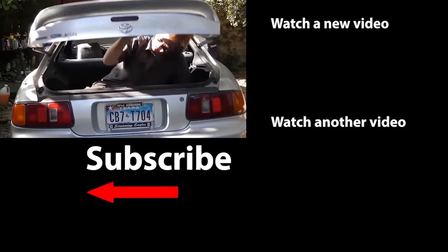Now that said, and if you find it's going to cost you $700-800 to change the heater core, you might try this. And I've seen it work. I believe one of them is called Lime Away. I've used Lime Away. And you could put hoses going into the heater core, take off the regular hoses, put hoses in, and fill it up with Lime Away. And let it soak there for like an hour or two, and then flush it all out to get it all out of the system. Sometimes that can take enough of the chemicals off that the heater will be usable then. You might give it a try.